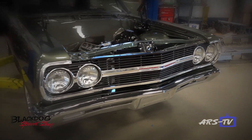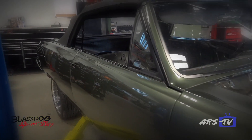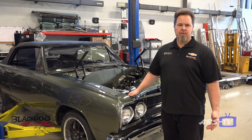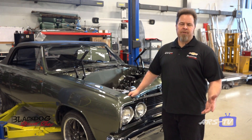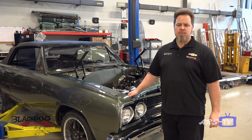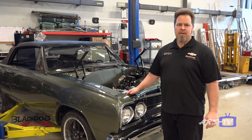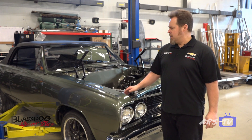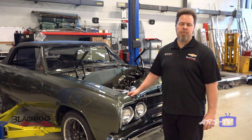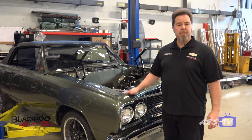This is a shop car, purchased a few years back from one of the major auctions in the country. It has a 6.2 liter and had a DOD cylinder deactivation system for better gas mileage. Our consensus is that it was initially built for a power tour long-haul scenario, so it had a 3.08 open rear end. We put a 3.73 posi in it and kept the 10-bolt since we're not throwing a whole lot of power through it — maybe 450 to the rear wheels. We're refreshing the engine and found some wiring issues, so we're putting a new harness in it. By the time it's done it'll run and drive as it should, and this vehicle will be for sale when it's finished.